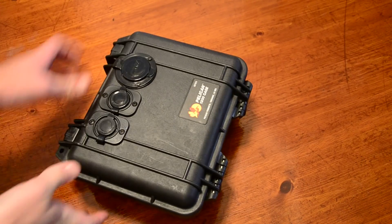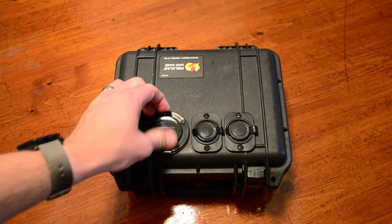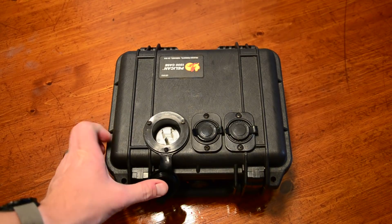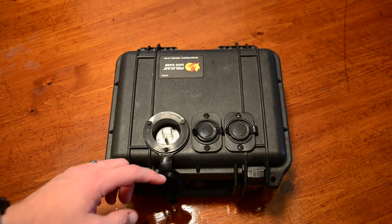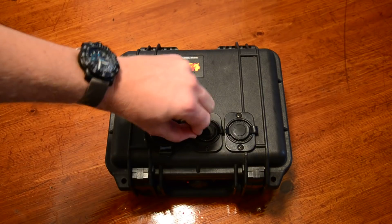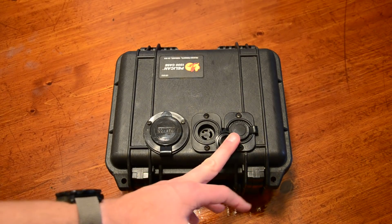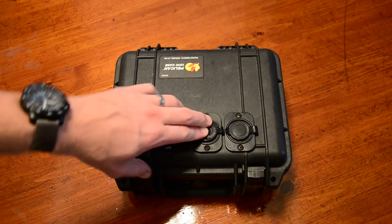On the top, I've got three different ports that I've installed. On the left, there's a regular household male plug — you take an extension cord and plug it into this part, and then you can actually put an onboard battery charger on here. It charges the battery itself, so you can plug that in and bring it anywhere you go. Right here I've got a three-prong connector — this is like a 12-volt trolling motor plug, but this is what I have wired up on my fish finder. It plugs in, turns, and locks into place.